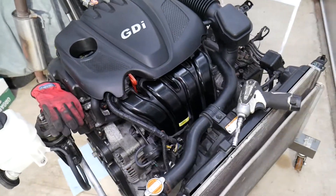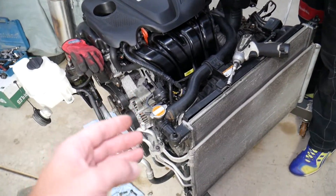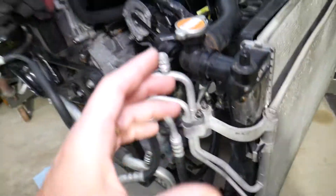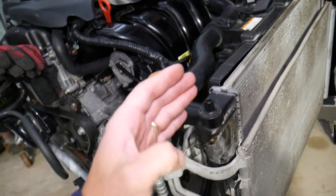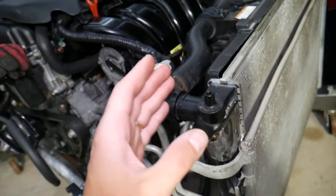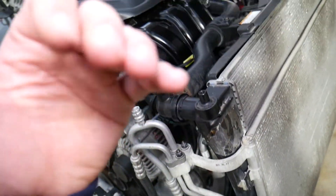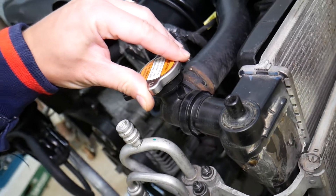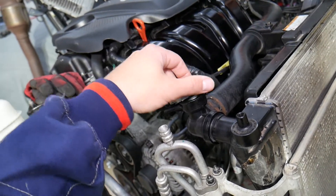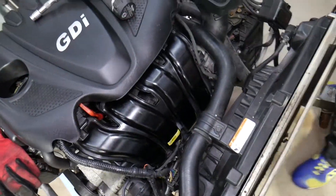We have the engine out so we can clearly show you what we're talking about. Before we start, here's a critical point: the cooling system radiator and everything is installed, and coolant actually runs through the throttle body. You cannot just remove and replace it without draining the cooling system first. The drain is right here. Make sure the car is completely cold — let it sit overnight — then very slowly open the drain on an absolutely cold engine, drain the coolant, then continue.